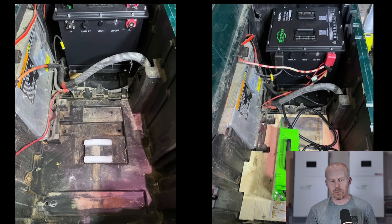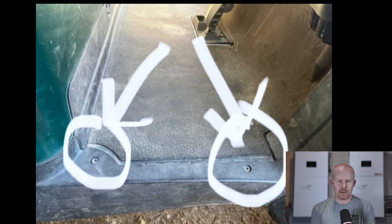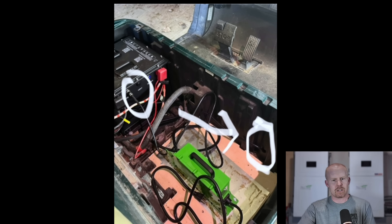He recommends foaming the plugs with recycled packing material before installing the plywood, to prevent water, mud, and debris from collecting underneath the charger and causing potential rot. Drain holes were left in place as they were small. Before final bolting, the Club Car battery area was vacuumed and wiped for excess dust and dirt. The last step involved mounting the monitor housing and routing the cable to connect it to the battery. Removing the two bolts holding the floorboard and mat trim allows access to the channel used for Club Car controls. The wiring channel required a hole in the battery box to be drilled in the front — no need to remove the trim strip, just remove the circled bolt, slide the floor mat back and fold it out of the way.